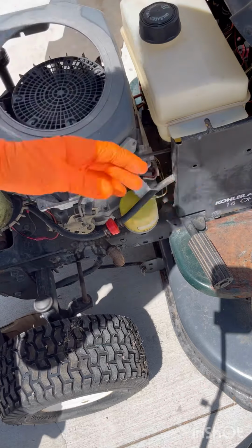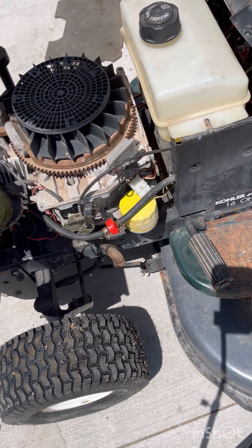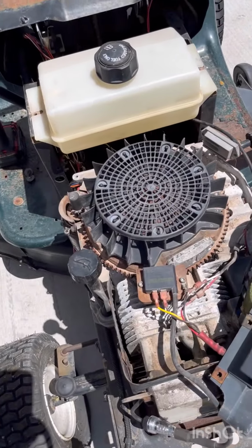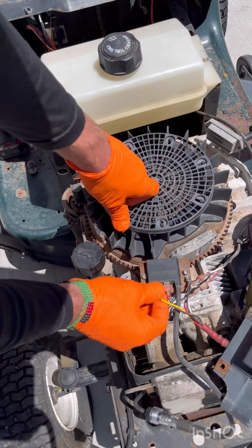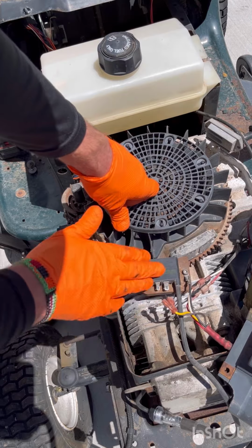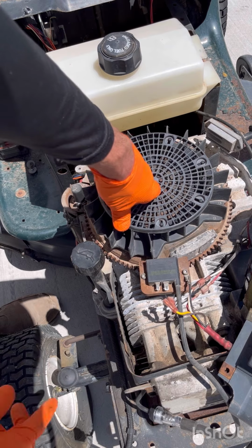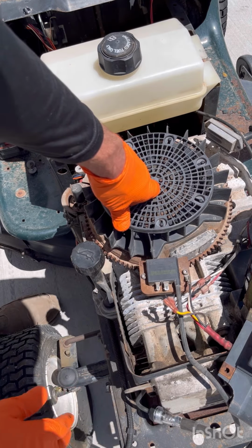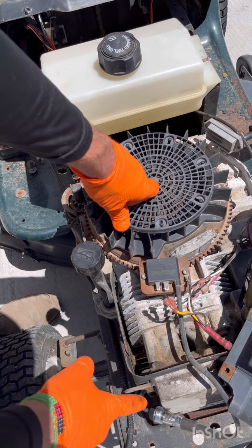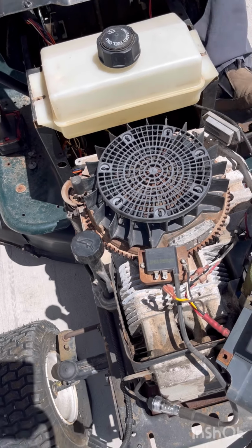Okay. That slides out, this pops out. Has some electrical up here. One thing that you wanna do before you replace your Magneto, go ahead and pull these two off the front of the Magneto. Sometimes there's only one, but one of those is telling it the safety switches are all plugged in. Once you have those off, that eliminates the safety switches. You also can't turn your machine on and off with the key, but this will tell us if we have a spark problem or if it is indeed just the Magneto. So go ahead and try to start it again.